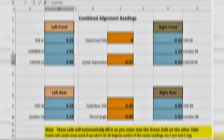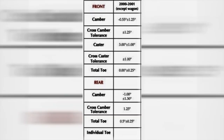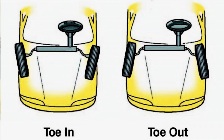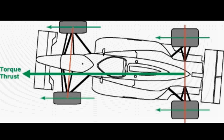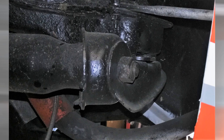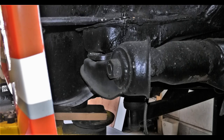So we have all the measurements — now it's time to make adjustments. If you're lucky, you'll meet the specs of allowable ranges. If not, then normally we would adjust in this order: rear camber, rear toe — and that also becomes thrust angle as well. Then we'll move to the front and do front caster, camber, and then toe. We'll start with rear camber, but realizing that on my car the bolts to hold the camber shims also adjust the toe, so we'll add and remove shims as necessary before we completely tighten it down. We'll adjust the toe as well.